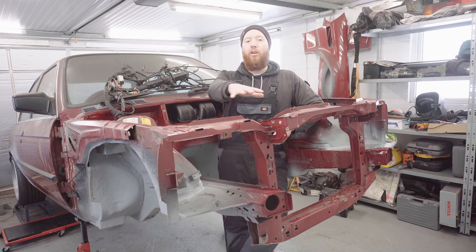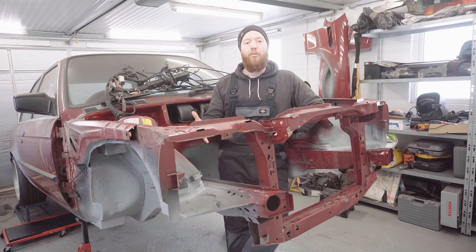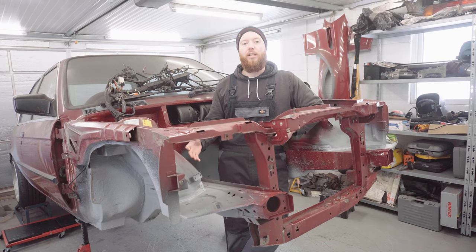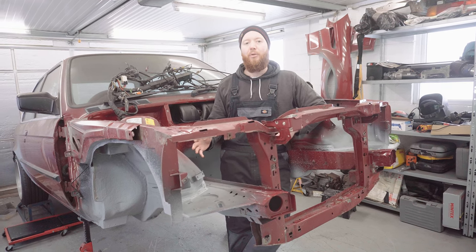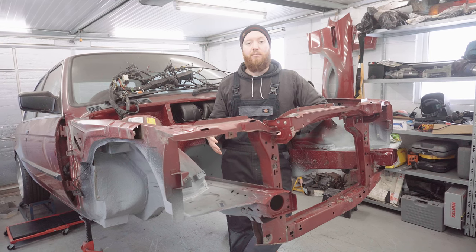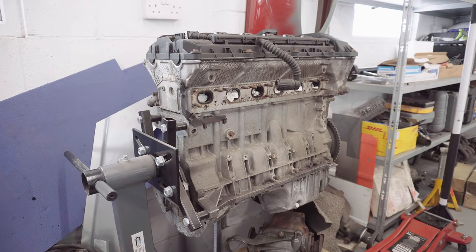While I've got everything off the front end removed that can be removed from the E30, it's almost an unmissable opportunity not to do a removable front core support on the car. Now, I'm a bit reluctant to do this because it wasn't in the original plan and I don't want to delay moving the project forward any more than I have to. But as this car is going to be an engine swapped car and the engine may need to come out and in a couple more times, it probably would pay to do a removable front core support on it.